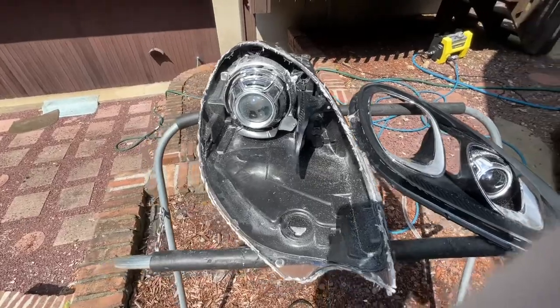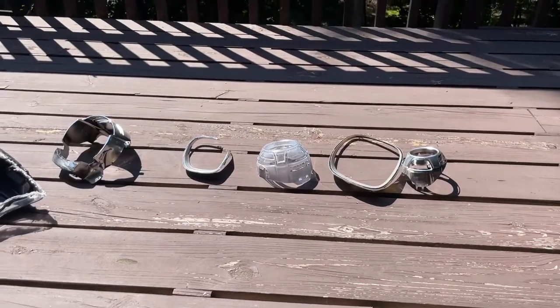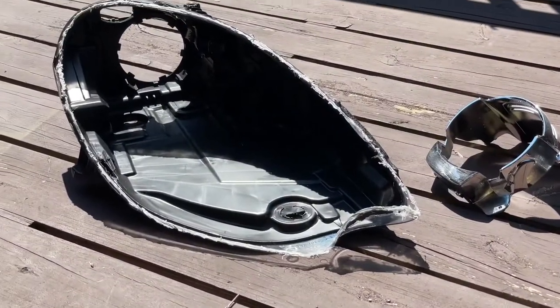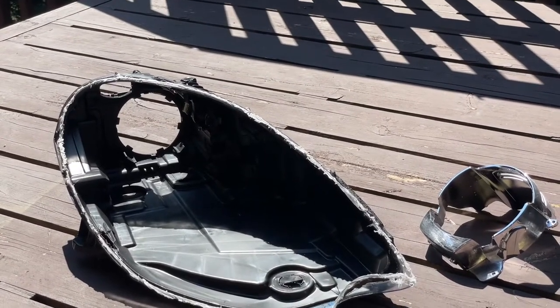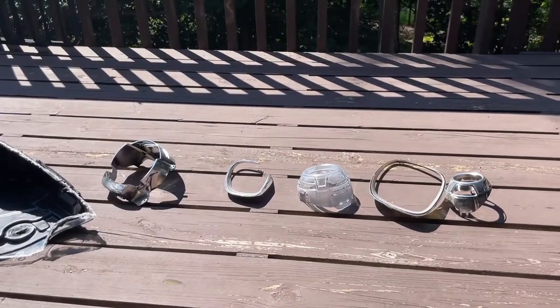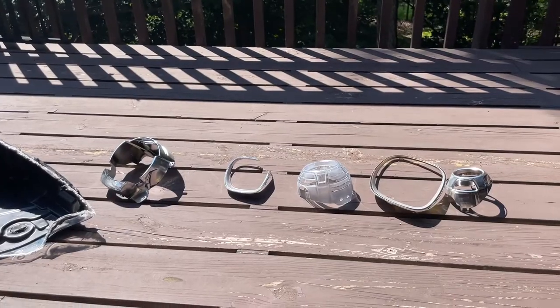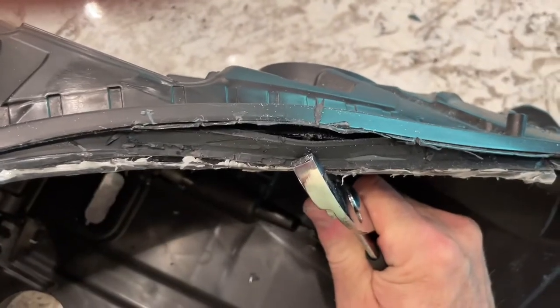Here is my housing all stripped out, and I have the components which I'm going to spray paint in a moment. The housing is going to go in an oven at 200 degrees for about 10 to 15 minutes — that's going to loosen up the butyl around the rest of the glass seal so I'll be able to pull that off. These components I'm just going to hit with flat black spray paint for plastics — it's a high-heat formula. The best way I've found is to take your exacto knife, run it along the outside and then inside on the butyl seal, and eventually you'll cut it to the point that you can pull it out.